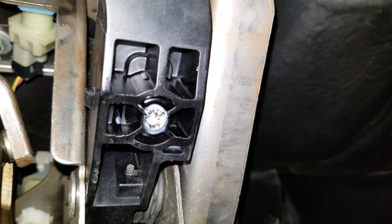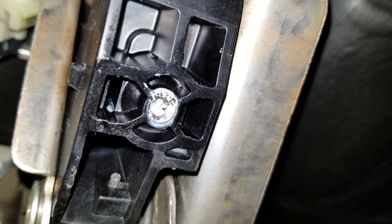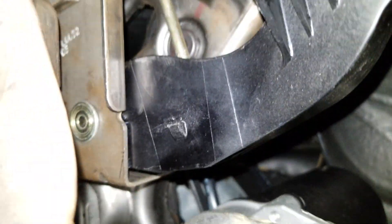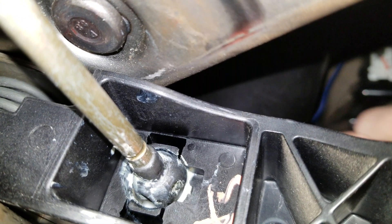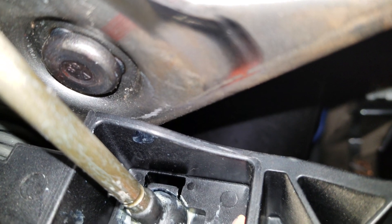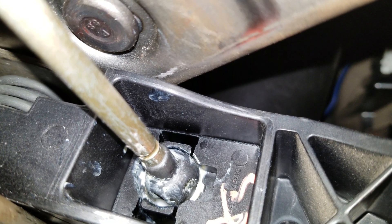So if you see a white piece — of course I think OEM might have been black. I saw them online white or black — but basically there's a tiny groove in there, and that's a little white piece that sticks through the front that keeps the bushing in place. The white tabs go vertically up and down when it's installed, because the clips that are on the pedal itself are horizontal, basically side to side — they clamp on the ball from the side. The white pieces and tabs basically go vertically up and down.